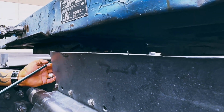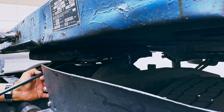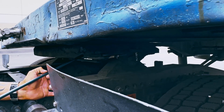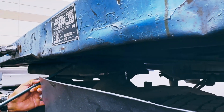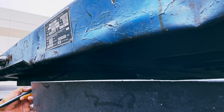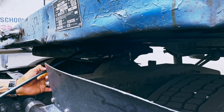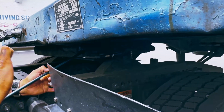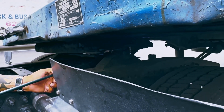This right here is my apron. This is my skid plate. Talking about them separate. They used to let us talk about it together. They want to hear it separate now. My apron on top, no cracks or illegal welds, well greased. My skid plate, no cracks, no illegal welds, and well greased. I should have no gap between my apron and skid plate.